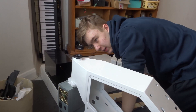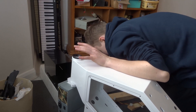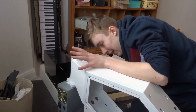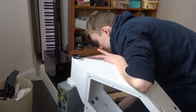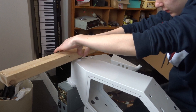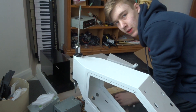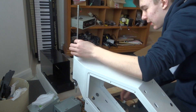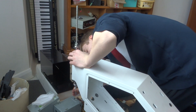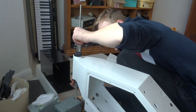That's not going to work, is it? The next part which is going to be quite tricky is getting these bearings into the headset because my frame doesn't come with that pre-done. Some frames have these kind of pre-installed. I don't have the special tool to do this — you can get them — and annoyingly my biggest G-clamp doesn't quite fit. So the only thing I can do is place a piece of wood on the top and gently use a rubber mallet to get it in. Okay, this may or may not work, but it's a very high-tech solution — I've got a rod going through the middle with essentially wing nuts and a bunch of stuff to make it the right thickness, and the aim is to tighten these down and gradually get the bearings seated.